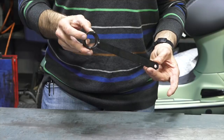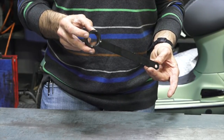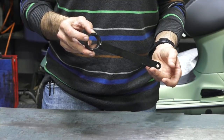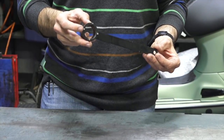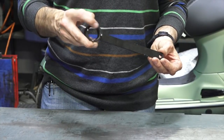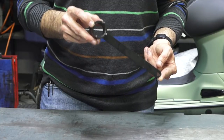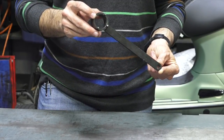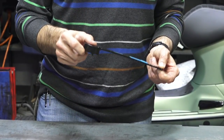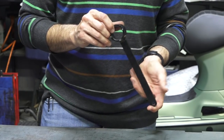This tool will slacken the nut on the front fork — say you need to dismantle the fork to change the steering column lock, you're doing a restoration, or you've got a bent fork. This tool engages the four-prong specialty nuts found on the top part of the fork and will dismantle the front fork on pretty much all vintage Vespas. Part number is Tool SN, and this part carries over onto the modern Vespas as well.